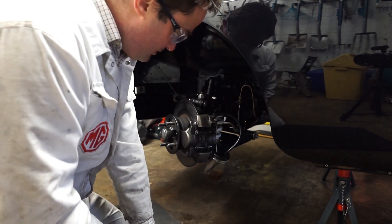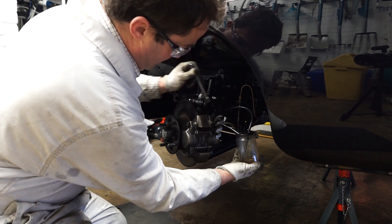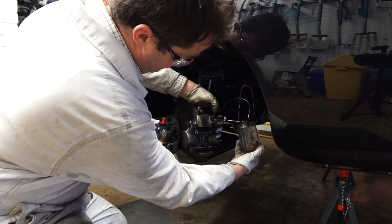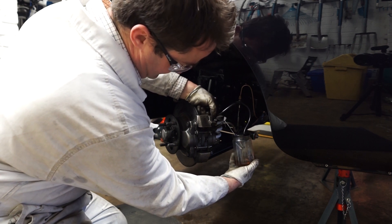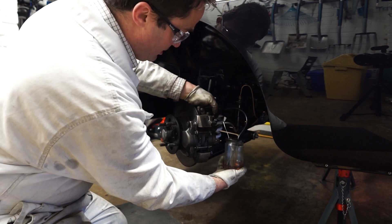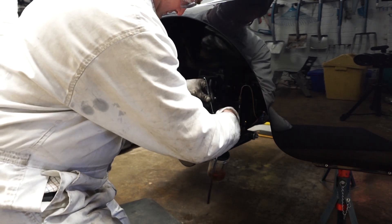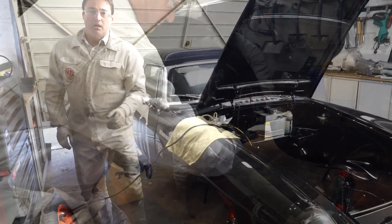Make sure that's on nice and tight. When I open the bleed nipple you may see some air come through — don't worry about that, that's just what's in the tube already. Once that's blown through I'll pinch it back with my finger and open it again to check for any more air, which there isn't. I'll let it open again just to put some more fresh fluid through the system. I won't film the driver's side as it's a bit tight around that side. Take the hose off, tighten it back up — you really don't want to do these up too much — and then go around to the other side to finish off.